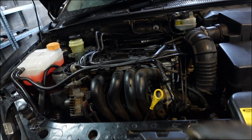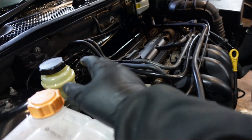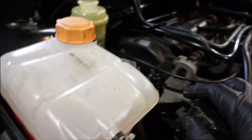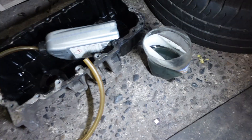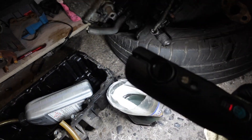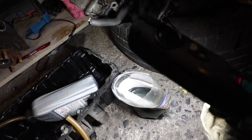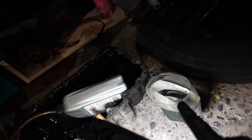In the meantime, this car is leaking power steering fluid. It's leaking from a switch down under there — I'll show you in a while. First I have to drain the fluid that's in here. What I've done is I have a bottle here. I'm just going to go under the car and crack that 19mm power steering fluid pressure switch and dump the fluid in there.